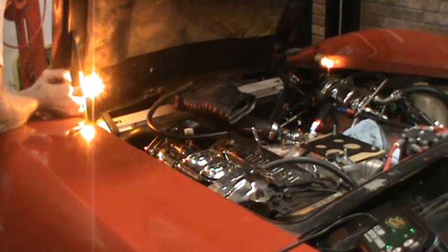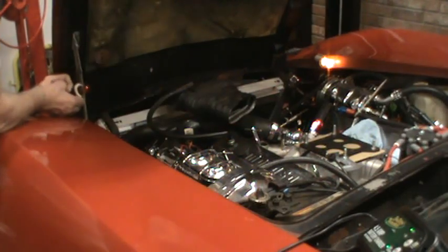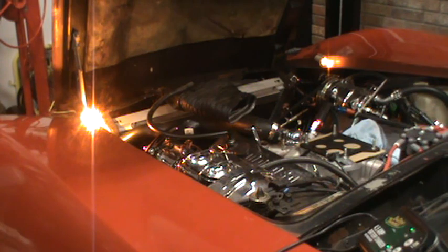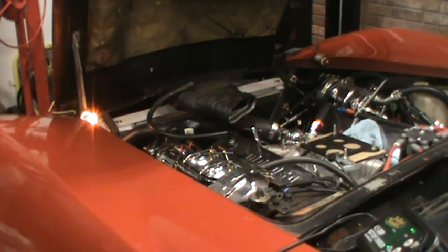It would appear that the ground wire on my new socket isn't making a good connection, because when I wiggle it, it changes what's going on there. I don't know if I can repair that with what I've got on hand. But at least it was enough of a connection that it lit the correct filament. But apparently not a good enough connection to trigger the flasher.